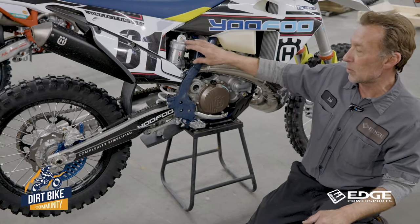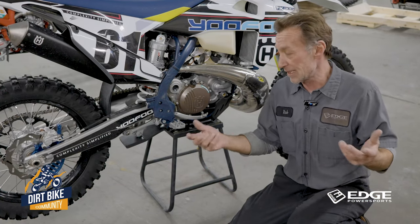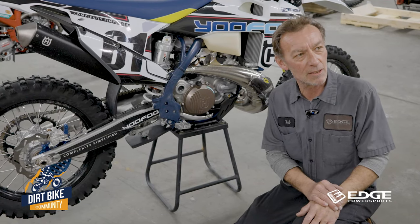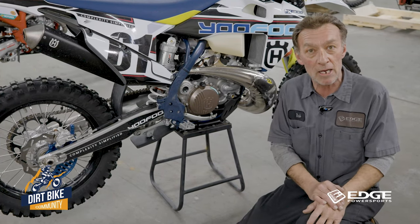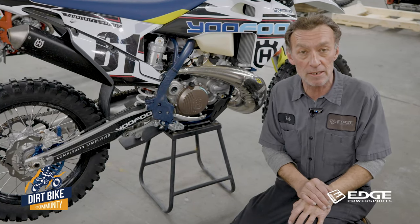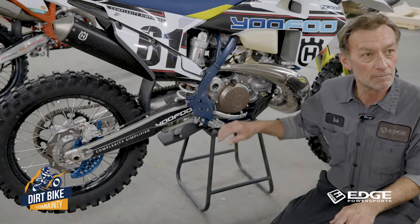Usually what I'll do is focus on compression first — go hit the same heavy bumps and get that felt out, and once that's feeling sorted, then I'll focus on rebound. Treat it like two different chapters or segments in the day and you can really pick out and identify what's happening. That's my process when it's a new bike, I've changed a spring, or maybe I've gained a couple pounds over winter. In my supermoto world, tires can also make a big effect — running a road race slick, new tires have more cohesion and that changes things too.